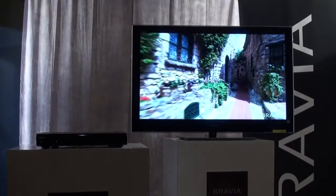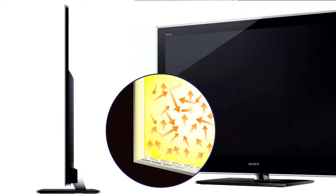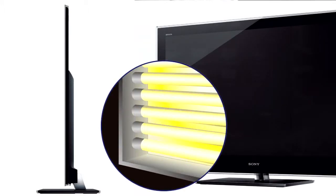So how do LEDs allow us to get these really thin TVs from an LCD TV? The way it works is to use LEDs along the edge of the TV firing in, spreading the light through a series of light guides to help give you the illumination needed for the picture. On a conventional LCD set, that backlighting is provided by a series of thin fluorescent lamps that create a panel which adds thickness to the TV. LED edge lighting eliminates that.